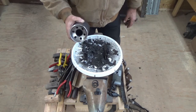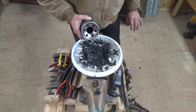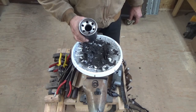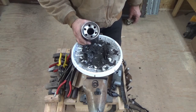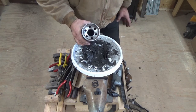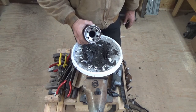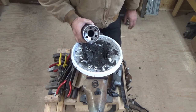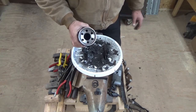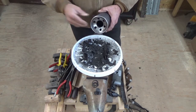And the reason that I even went this far is because the biggest improvement that I found dealing with this hydraulics is when I changed this filter with the one that's on it now. That was under 900 hours. I'm at 912 and some change right now. I'm using the Firestar fluid, and I did check it. It's full. There's no moisture, no milky. It looks clear as water, without the water. But yeah, I'm determined to get this squared away.